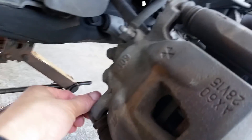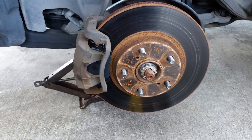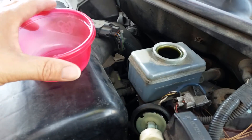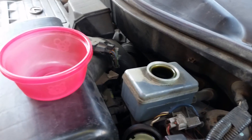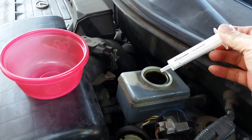I'm just gonna reverse the process, tightening this bolt. I already got it started — I'm gonna tighten it, put the tire back on. This brake pad is done. As the piston's been compressed back, the fluid is going up, so I'm gonna make sure I pull some of it out so it won't be spilling all over the place.